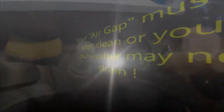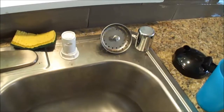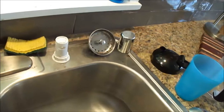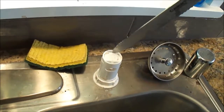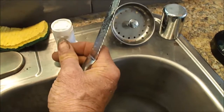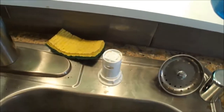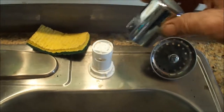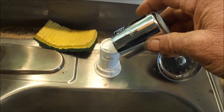This is your air gap here. This has to be cleaned out probably once a year. If you notice that your dishwasher is not draining properly you need to check this. This thing here basically pries open — I'm not going to do it right now but you get the idea. There are these little tangs right here on each side, and then the centerpiece comes up and you can clean that out. That's been one of the number one causes of poor draining dishwashers that I've come across.